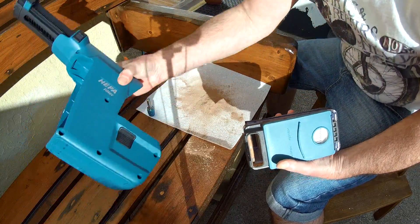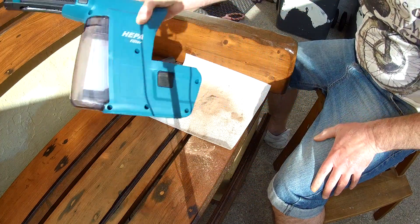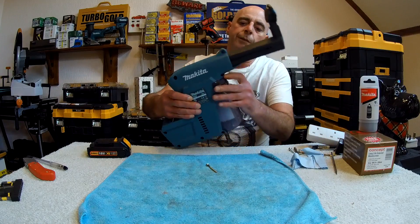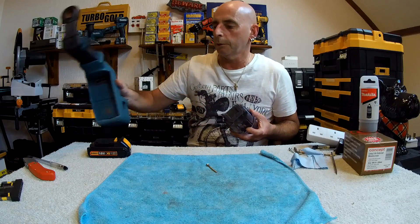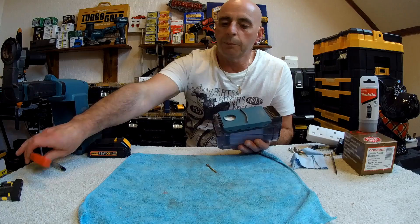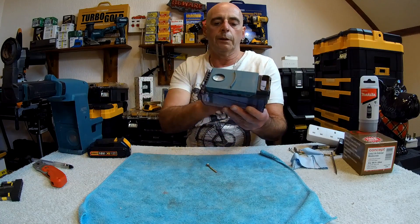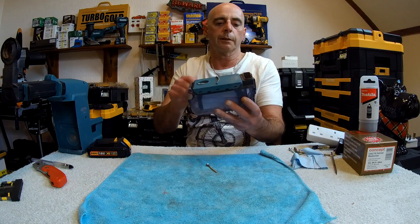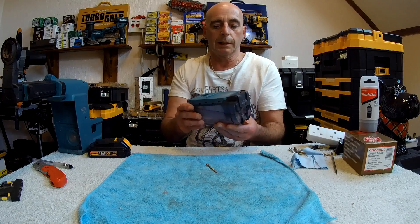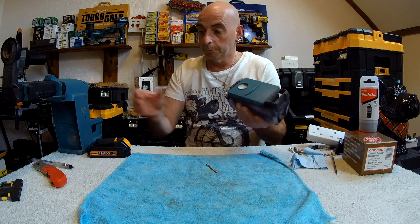Clip it back into place again — there's that bit, clipping like that, and it's back in place. Now, what I found with the HEPA filter was — when you turn it like that before you go to empty it, if you tap it with something light, all the dust in the filter falls out and goes into the collection area. I did that and it worked, so there's a tip for you.